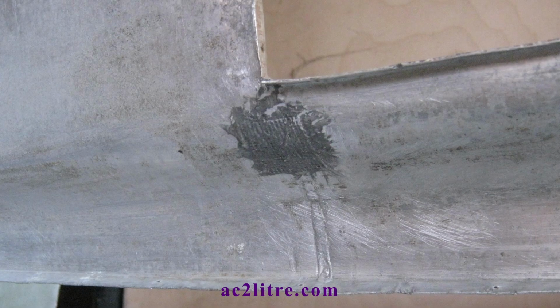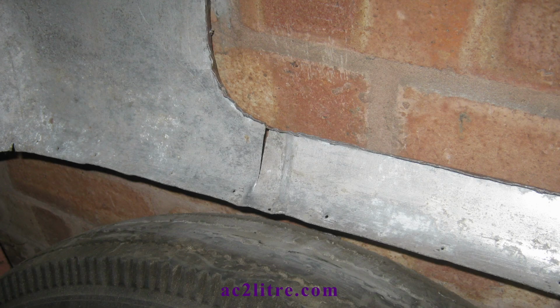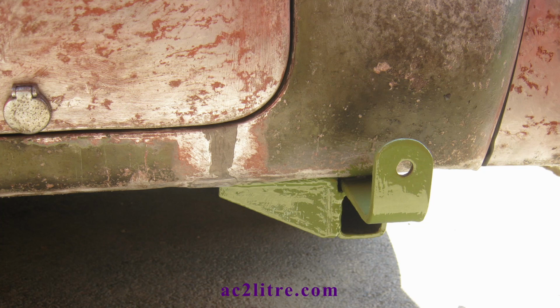For the door corners, I reinforced the lower ends of the cracks, which are accessible with the car fully assembled. With hindsight, I should have reinforced the outside of this big crack to hold it while the body shell gets lifted back onto the car.